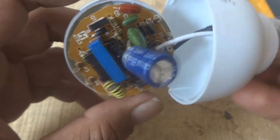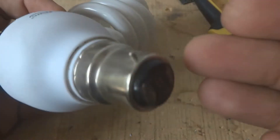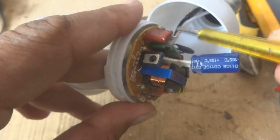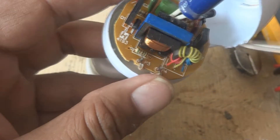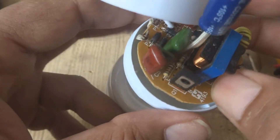We are going to troubleshoot like a black box. There is an inverter here - 220 volts. These two prongs carry power to the PCB, and these two wires bring power in. There is a fuse here in this black wire - you can see the fuse. The fuse could be blown. Then there is an output to the lamp.